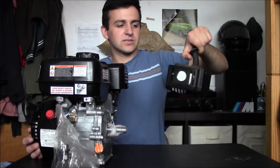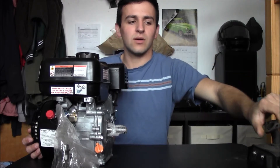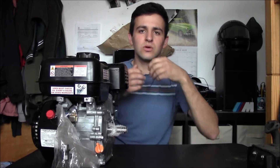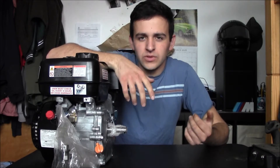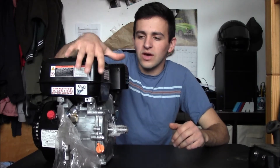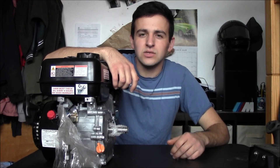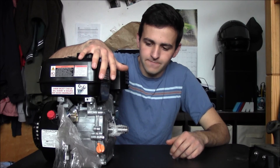The stock exhaust is a muffler so it's quieter but restrictive. Adding an aftermarket exhaust lets it breathe a lot better. The key principle is: if you add intake, you have to also have air out, so both sides breathe well. The more air you flow into the engine, the more power you'll make, but you have to match the fuel accordingly so you don't lean it out. OMB Warehouse also has a lot of Q&A where you can ask questions and they'll answer them. Thanks for watching.